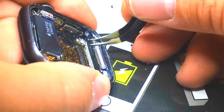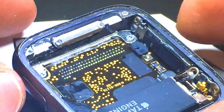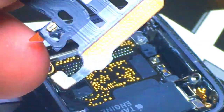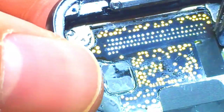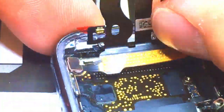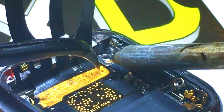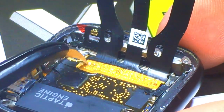Next I'll go ahead and try to pry up the rest of that Force Touch connector — it was so glued on there, like when that one kid was dared to stick their tongue on a metal pole in the middle of winter. Here you can see the new adhesive and the underside with both connectors. There are two guide points, one on either side, and little windows that you can look through to see the little squares on the board and line it up. Another thing that helps line this connector up is to flex the cables and also connect the connector there — it'll help line up the sides. Once you have it lined up and can see the little squares through the windows, go ahead and tack down that side, then adjust the other side and do the exact same thing.